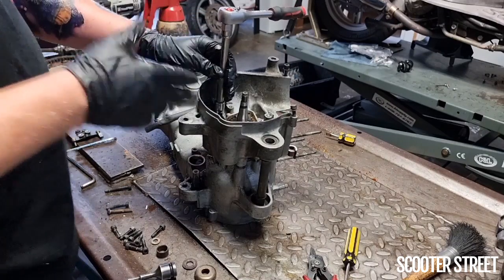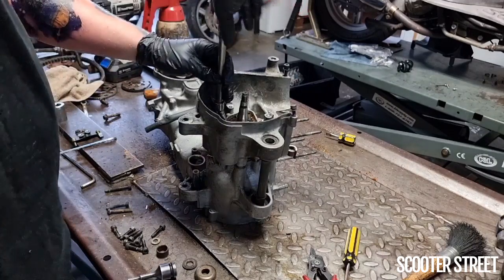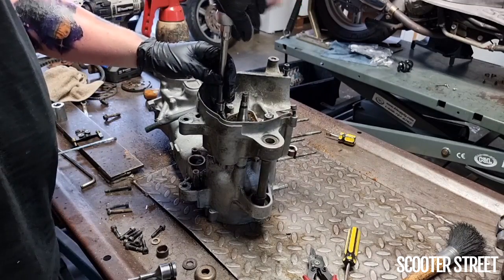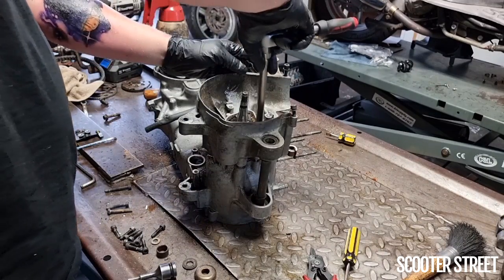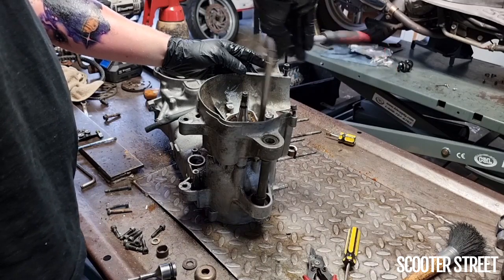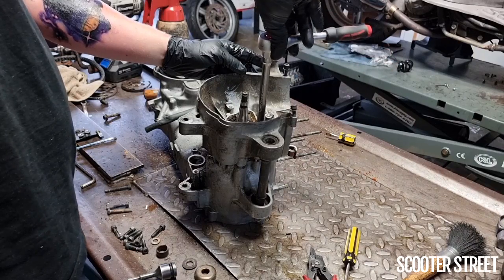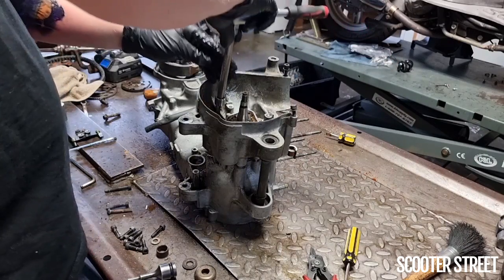But if the bolt is loose when you get to it, you don't start that quarter turn tighten until you feel that the bolt has grabbed, like there's tension on that. I come to say a bolt that I haven't touched in a couple of turns. See, that one just is loose. So I'm not going to start counting the quarter turn until, there it is, it's under a little bit of tension, and now I turn it.